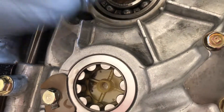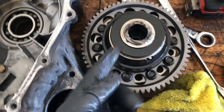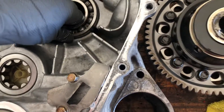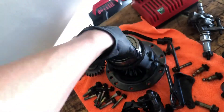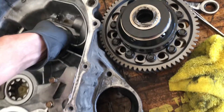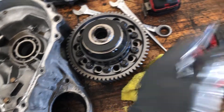The bearing's still good, but you can see some of the guts of what used to be a really good differential. Look at that — that versus that — obviously something wrong there. It should just pull out without having to knock it, but I might have to hit it with a mallet from the other side. Both of these bearings are good, but I don't want to pull that one off and damage it. I can probably just knock this one out, save it, and have a spare good bearing. We'll put this aside, knock out that bearing, then look at the ring gear to see if it lines up.